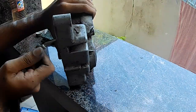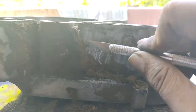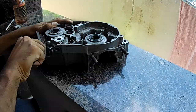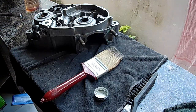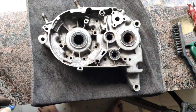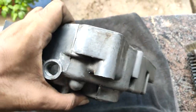The gasket material is great at making dust and dirt stick to it. I cleaned the exterior with a pen knife, and the bottom part was ridiculously bad — completely covered in filth. I then used a brass brush, some thinner to remove grease, and a soft paint brush. I got advice to keep the case over a piece of cloth to avoid scratches. After a long time of work, the exterior is a bit cleaner — not entirely happy with it, but further work would be done. All the extra unnecessary gasket material has been removed from the sides.